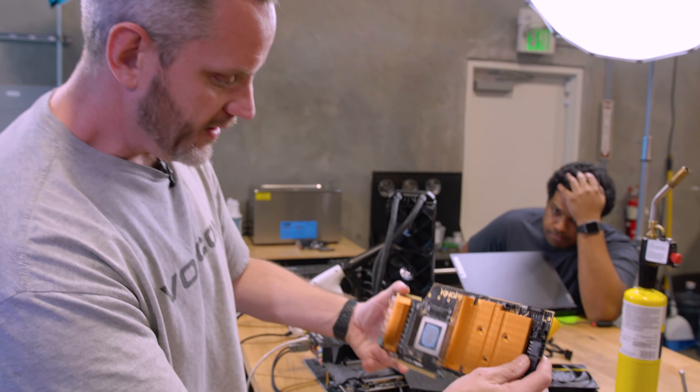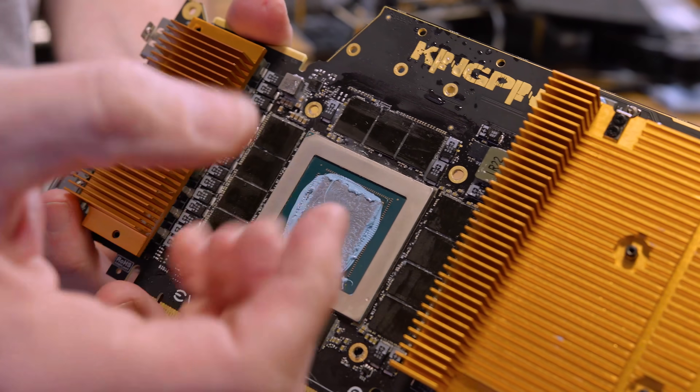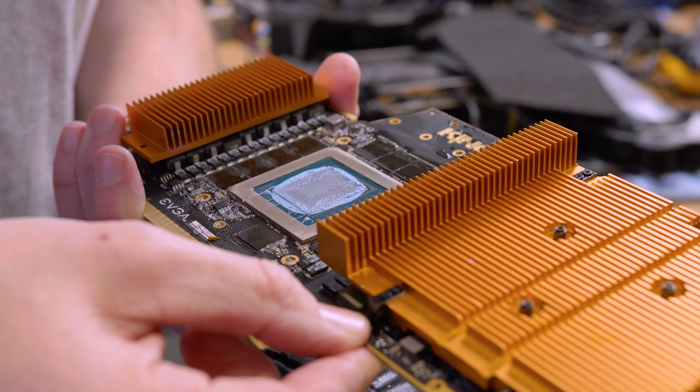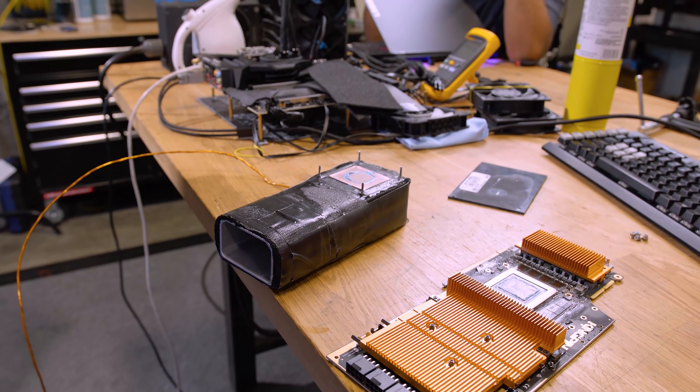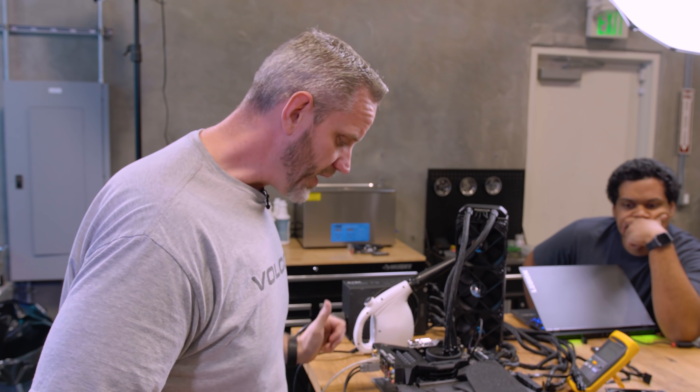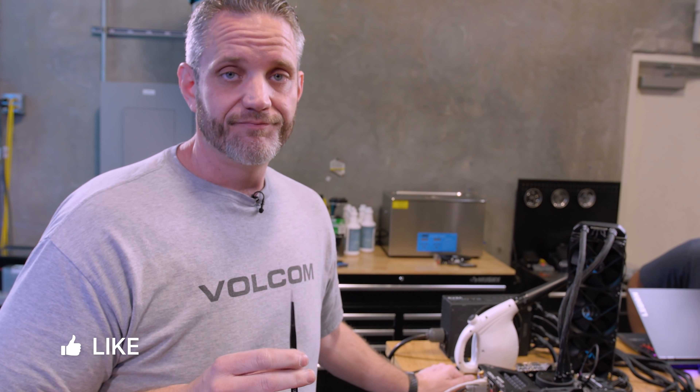Vince will be able to repair that no problem, but let's check out the mount. I do have another Kingpin card that I'll probably just lap real quick and test. If I go ahead and pull that straight up — we're getting a much better mount. It has a little bit of that goopiness from suction when you pick it up, but I can tell you right now it's getting to the edges better. On the second card I do this to, I'm going to lap it with something a little coarser grit. The lapping part was a success. The careless part of knocking off a capacitor — utter failure. This is the risk you take when you get in a hurry and aren't careful. Thanks for watching, and if you want to know if I actually ended up beating my score, just periodically check the Port Royal Hall of Fame.